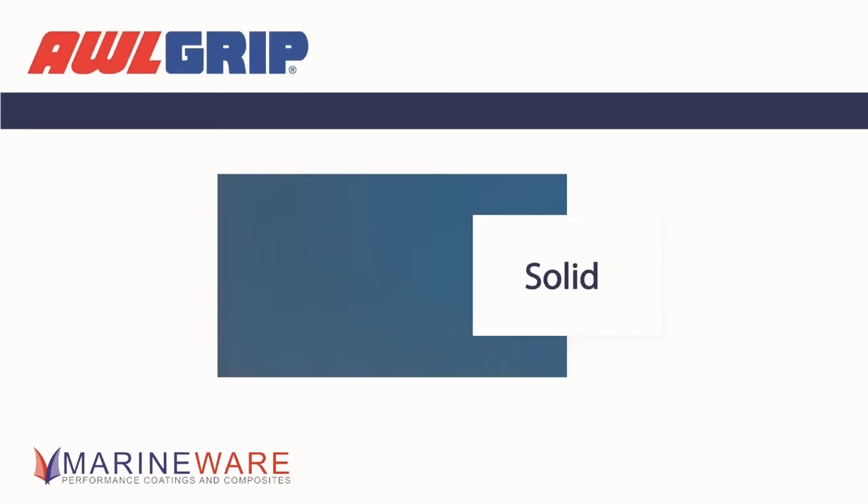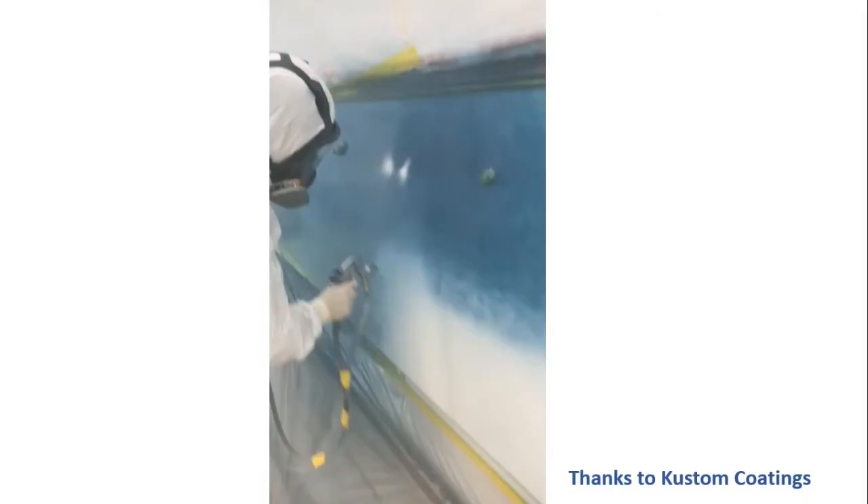The last product in the range is SE Solid. It's again a two-stage — a solid colour with a clear coat over the top. The positives include repairability: SE allows the colour effect to be applied first and then the gloss and luster added via the clear. We also get really good protection from that barrier of clear. Customers using classically difficult colours — yellow, red, orange — find it covers well and the speed lets them apply several coats quickly to get coverage.